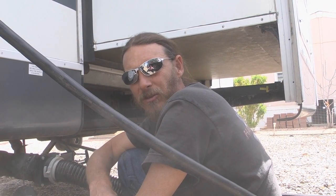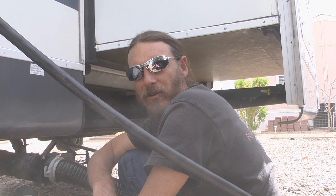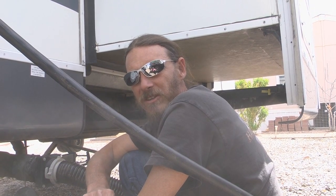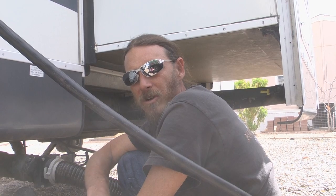When the toilet starts to burp, you know your black tank is full and it's time to dump it. What we like to do is make sure that we have enough gray water saved up. When that black tank starts to get full — after you've been RVing for a while you can tell — go ahead and close your gray tank at that point so you can save up enough gray water to flush everything out.